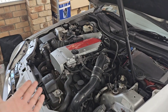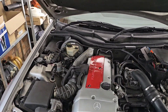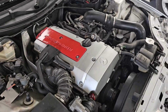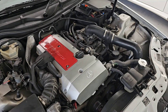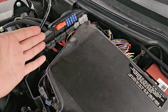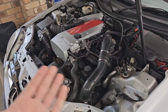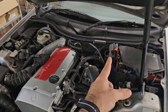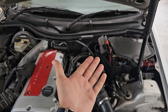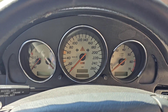Now the engine is running perfectly and can rev up perfectly as well. I put back my old original K40 relay and the engine is still working perfectly — there's nothing wrong with my K40 at all. There was nothing wrong after resoldering the points. The idle speed issue is solved.